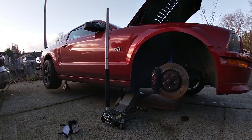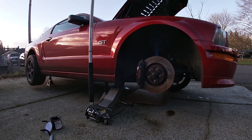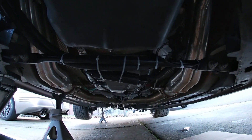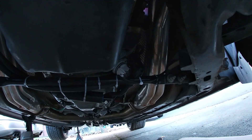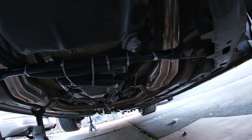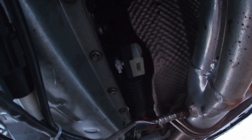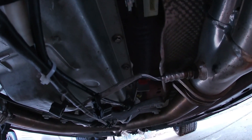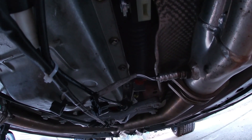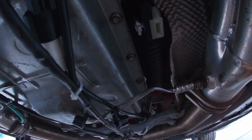I have the Mustang here up on jacks. We are very limited on driveway space, so just kind of had to make it do this way. Under the car, what I did was just got some of this cabling out of the way. I had to work on the shifter. Basically what I did is I popped off the shifter linkage from the 6R80 there, and unbolted the bracket, and pulled it up through the top. Got the new shifter on there — I have a stock 05-09 Mustang shifter in there — and got this bolted back on.